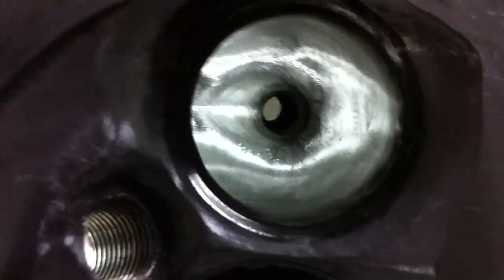We're waiting for those to come in so I can get in there and finish areas I can't reach with the short mandrel. Looking down the intake port here, you can see the dark areas — that's casting. These edges I'm going to need smaller tootsie rolls or a tapered tootsie roll to get down in here. But back in the back is what I'm talking about where I couldn't reach — that's just casting back there and I can't reach it without my long mandrel.